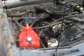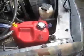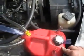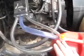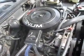It's kind of hillbilly and cheap, but I did make it work a little bit. Here's the inside of my truck — there's a little two-gallon gas can sitting here. How this works is these hoses — I've got three hoses that go down to the bottom of the tank. These are air hoses that go into the air cleaner. The motor sucks in air through these hoses and pulls out the vapor from the gas can, causing these hoses to bubble the gas, and the vapor comes out into the top of the air cleaner.